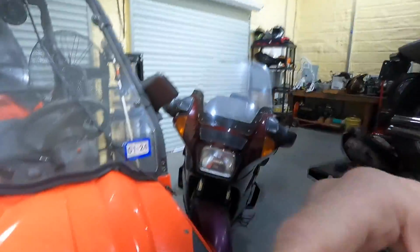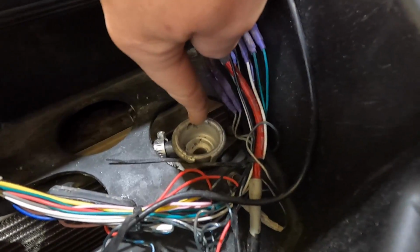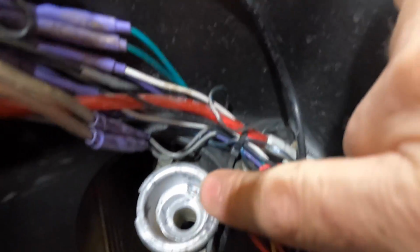We have now put a new head gasket on the front of this thing because it had a head gasket leak also. And now I run across this after cleaning, because yesterday after warming it up and everything, I thought the radiator cap wasn't sealing right. So here's what I ran across now. I cleaned it all up. I don't know if you guys can see this or not. There's holes eating through there, all over this thing.